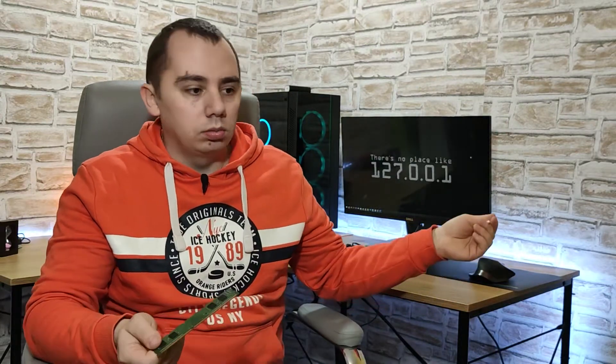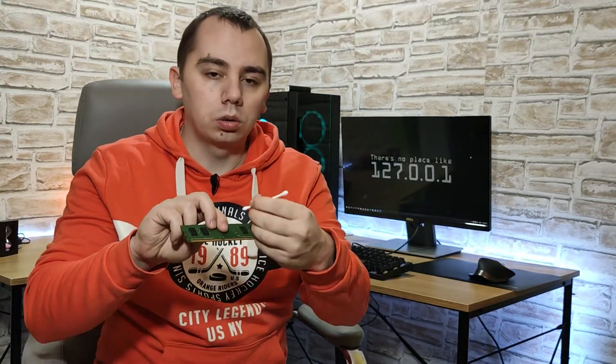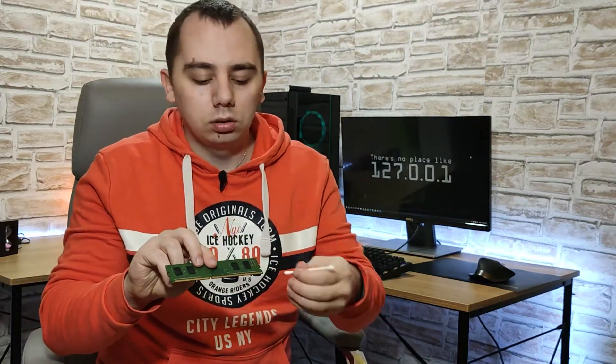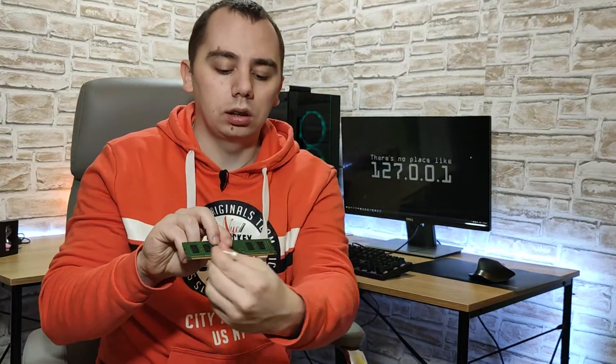Such as your PC won't boot even if the memory is actually fine. A quick way to try and troubleshoot this is to take the RAM module and use a Q-tip — one of the methods — with rubbing alcohol of as high purity as you can find. Isopropyl is preferred, but even 70% alcohol works. You just take the Q-tip, dab it in alcohol, and try rubbing the pins patiently. I prefer to brush with the connectors, not against them.